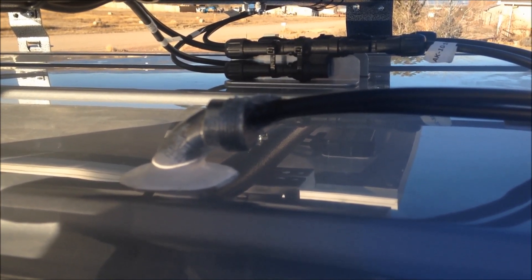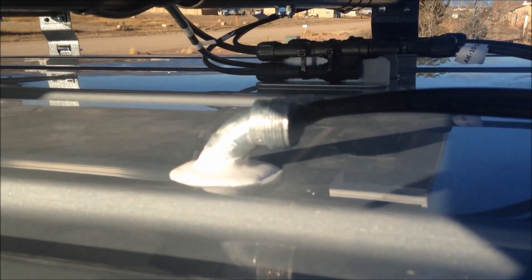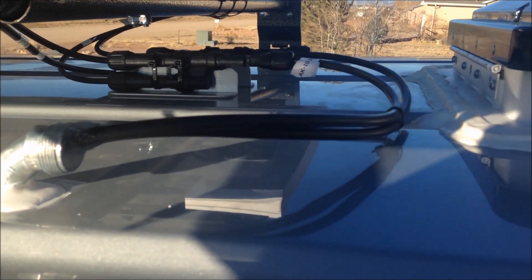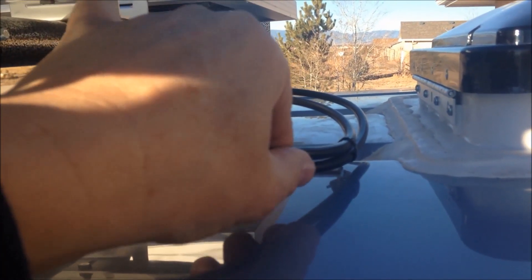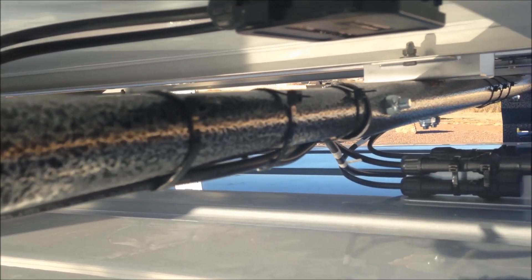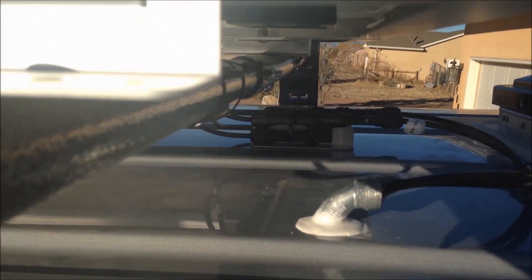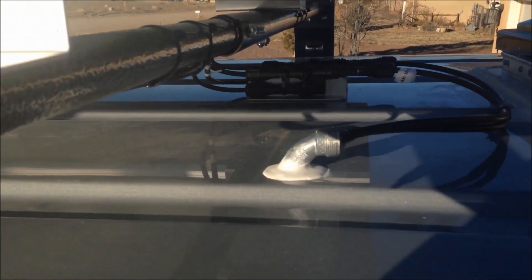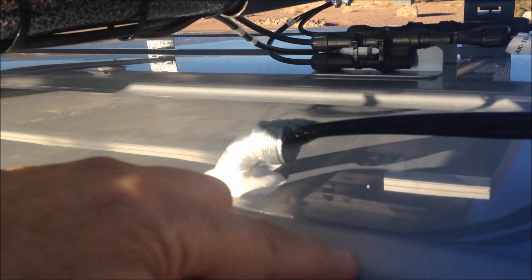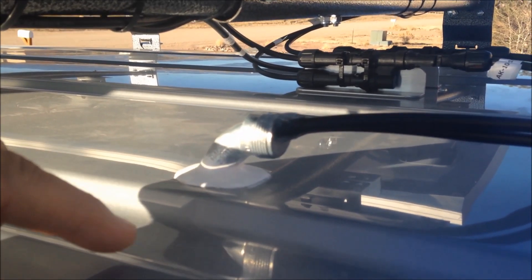If I do end up with a leak, I can actually seal it from the inside with silicone around the inside of the hole, but I didn't really plan on doing that — eventually it's going to get covered up with the roof paneling. This also secures those wires so they're not flapping in the wind. I've got three outdoor-use zip ties holding it to the back of the rack, and most of it is underneath the solar panel, so even in a downpour it's not going to receive direct water. I also put it on the high spot so water runs down into the channel and off the roof.